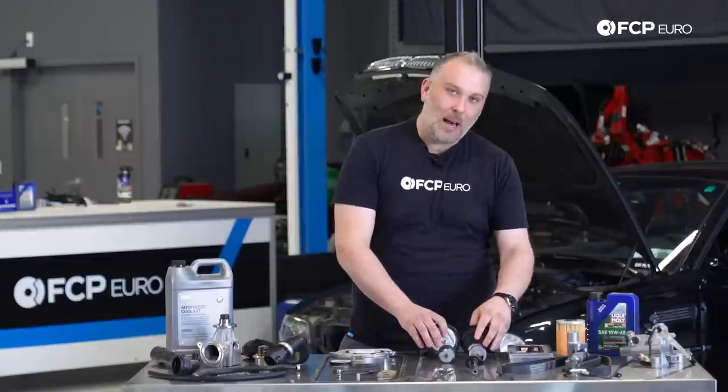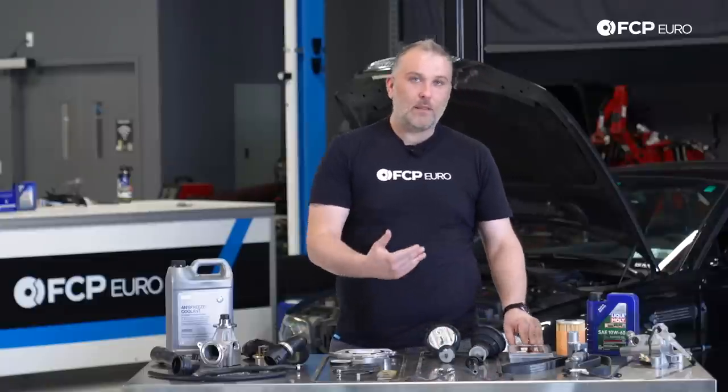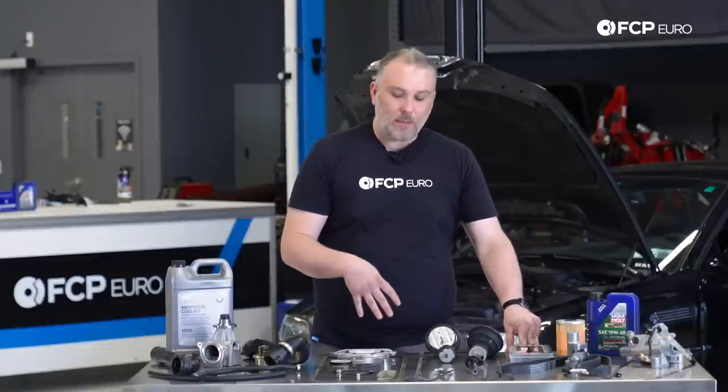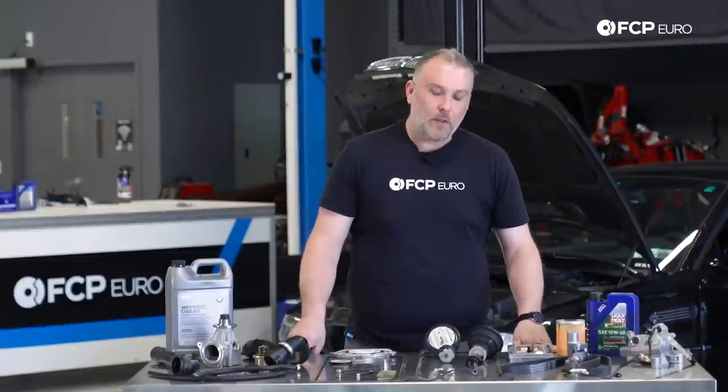So that's one of those jobs where if you're going to do it as a preventative, if you're going to do it to stay ahead of the curve, you're going to knock out a bunch of these other projects at the same time. But it is something to be aware of. Plenty of information out there about it. Don't be frightened by it, but just know that it's somewhere in the background. And one thing that you can do to help reduce this problem is use really, really good oil. Change your oil regularly. Allow the engine to get up to operating temperature. Some real basic maintenance things that are often overlooked.